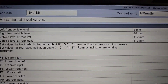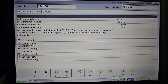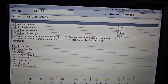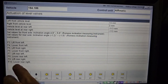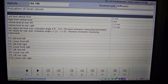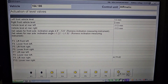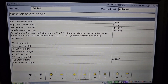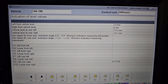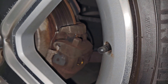This really means there is a big problem here — the pressure cannot be raised, so there should be a big issue with the rear airbags. I can easily raise the front of the car and it goes straight up, but as soon as I try to lift the rear right by pressing F9, it's at minus 113. If I activate it, it comes up maybe one or two millimeters and then I start hearing a hissing noise like a puncture. So there's a big puncture in the rear airbags.